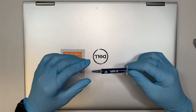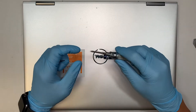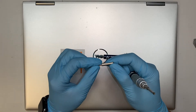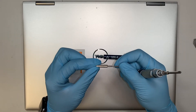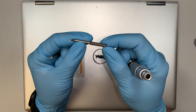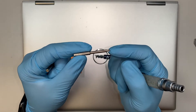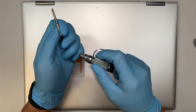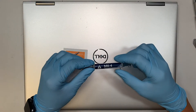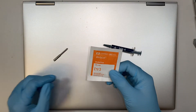Some of the things that you need to have on hand for this repair: get yourself a Phillips screwdriver — you need the PH000, that is the size of the screwdriver — and also the PH1, which is the larger Phillips screwdriver. And definitely you need to have a new thermal paste to apply and alcohol wipes to remove the old thermal paste.